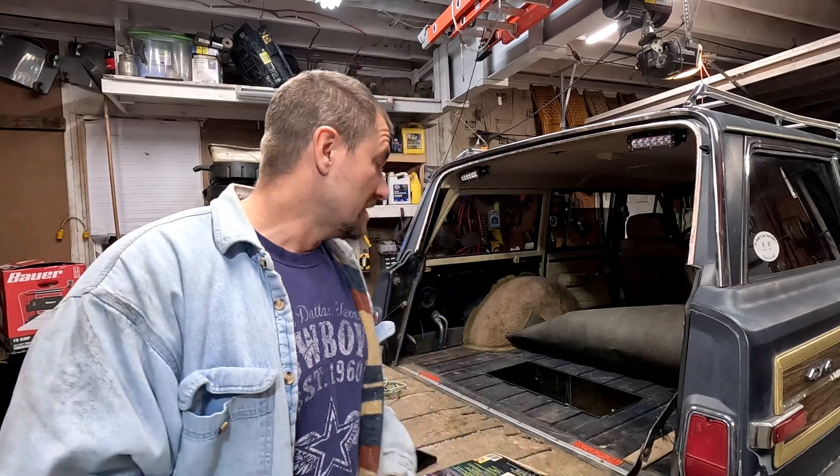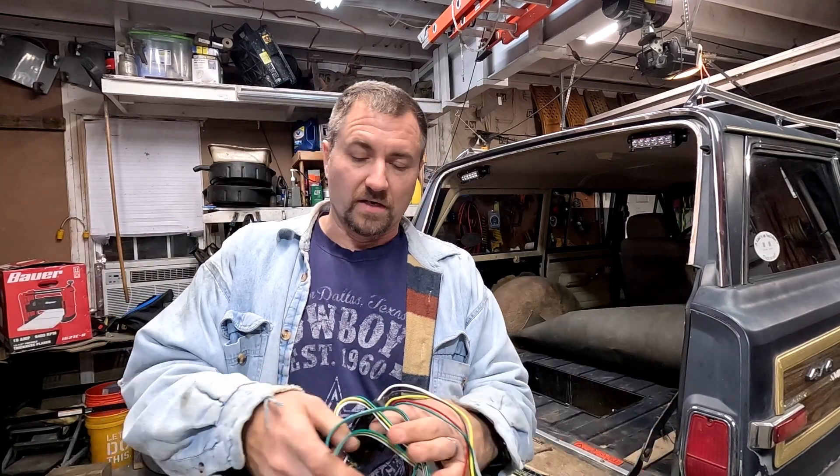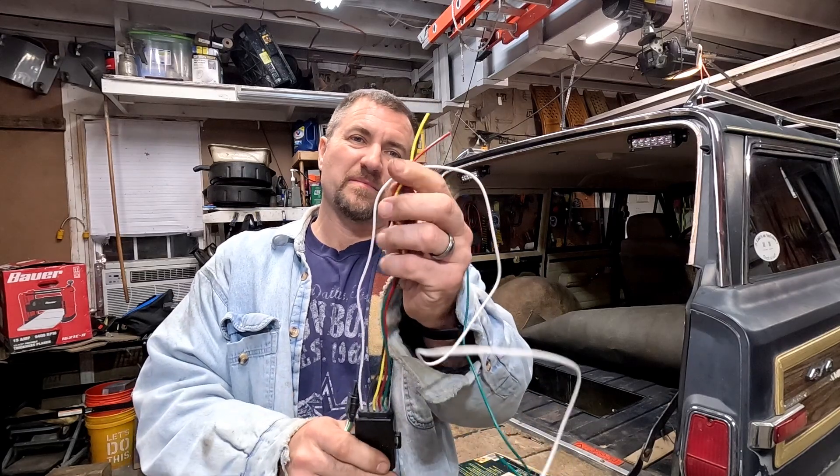So today, I'm going to go ahead and wire it up for a trailer. Now, it does have a tow hitch, it does have wiring underneath, they do sell little brackets and plugs and all that stuff for these vehicles. I did not pick one of those up because I'm going to do it a little bit more old school and DIY because these things were cheap. Now, all I did was actually pick up a little module off the web. It has the 4-pin connector for your trailer, but it also has a bunch of little wires. The green one is nice and long because it's supposed to go all the way over to the other side. I'm going to wire it from inside because I'm going to be splicing in two different types of wires, and I'd much rather have it on the inside because then it'll be more weather protected.